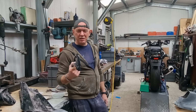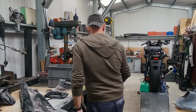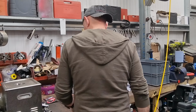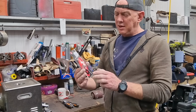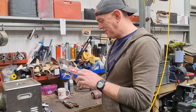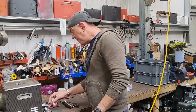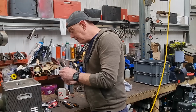So I've got some other stuff turned up. So the clutch slave kit is here. Where's he gone? Where is it? There you go. You don't get a lot in a service kit for a clutch slave cylinder on one of these. It literally is just a spring or oil seal and a cover for the nipple, that's it. All this lot is lovely and clean. It was until I covered it in dust. So that will just get reassembled and stuck back on.